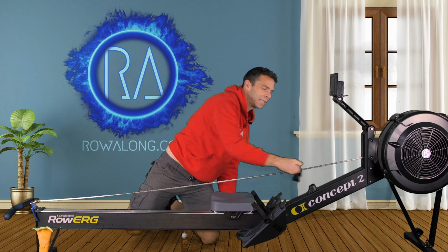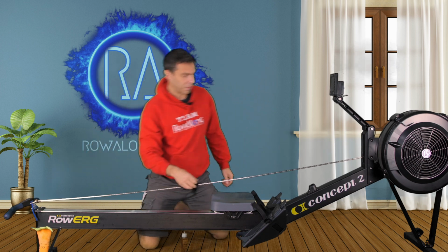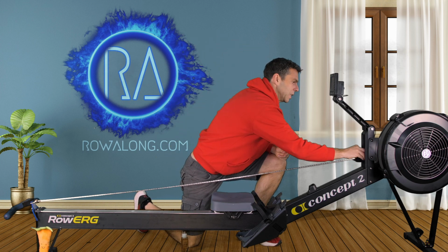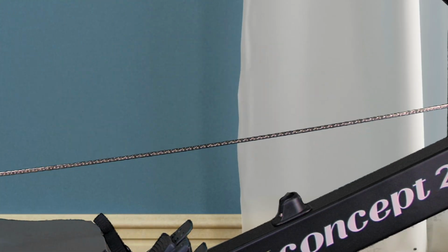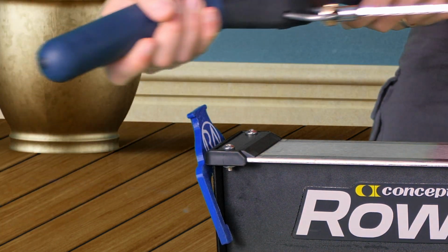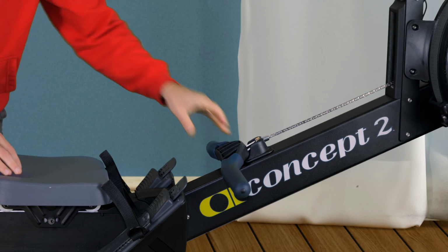There you go. And this is letting me lube the entire length of the chain, and there's no risk of this coming up and smacking into the front of the machine again. That's wiped off all the excess as well. And then when you're finished, you just turn the handle, lift it off the hook, and it goes back into the holder. Yes, it's a bit of an extravagance, but if you're like me and you like your gadgets and toys, it's quite nice to have it lying around to help when it comes to lubing the chain.